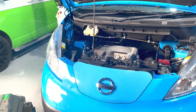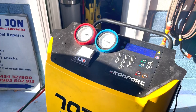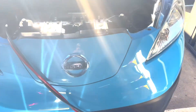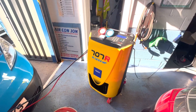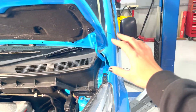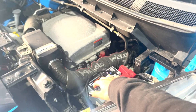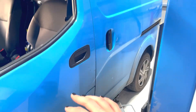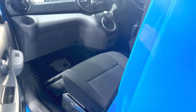The first step I've already done is degas the air conditioning, because the AC goes into the battery. The second step is disconnecting the 12-volt battery — you want to close all the doors, leave it for five minutes, and then disconnect the battery. And the third thing I've done is remove the master service disconnect.